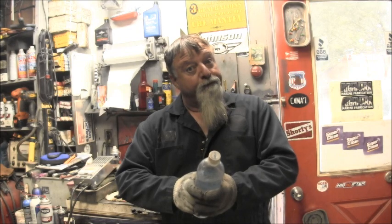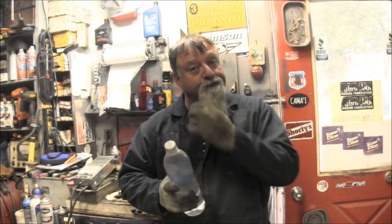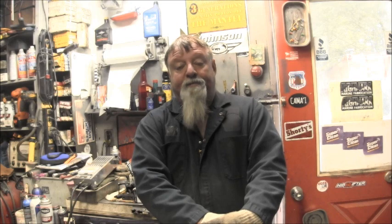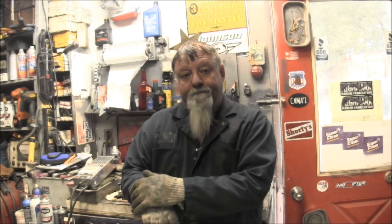Well now. Sometimes that's how it goes. I called the owner on this 30 Johnson. Told him what I found, that the power head was coming off, and best I can figure is it did a little damage to the exhaust portion of the power head to leg gasket there. And he really needed the motor. I showed him the broken lower motor mount.